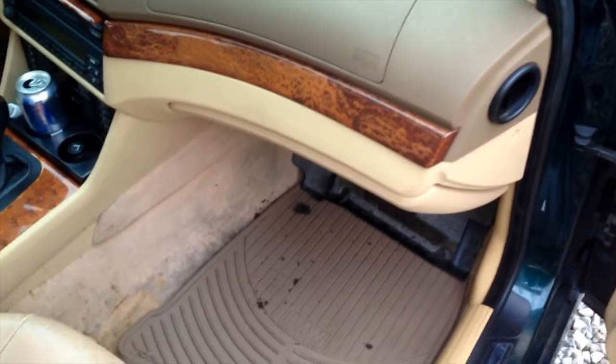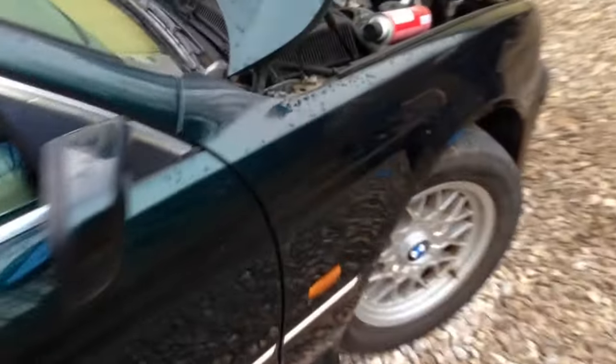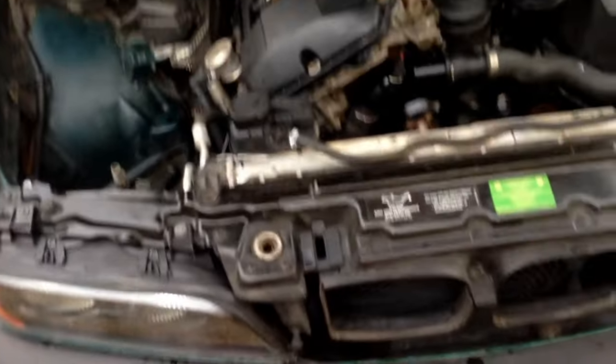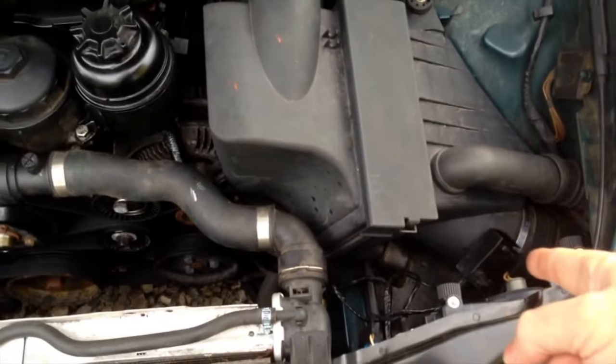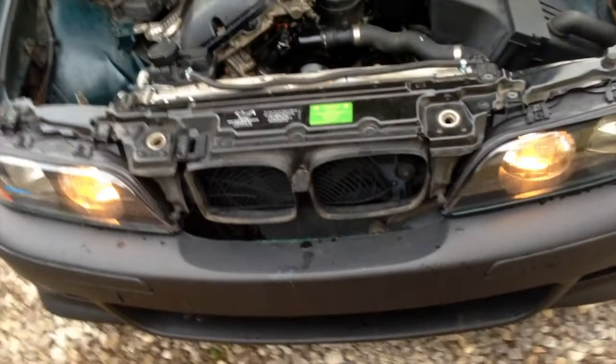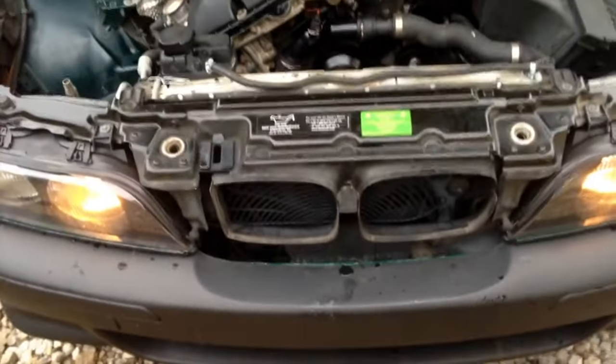At this point let's go ahead and do a little more inspection under the hood and see if possibly that black relay box is shorted out and causing the whole thing not to work. The final solution would be that the actual fan itself is bad. We have another one of these little relays — it's easier to just snap it on there first and see if that un-shorts it or makes it come on. Looks like it's gonna be one of those days — we switched the little relay box and the fan still does not come on with the AC.